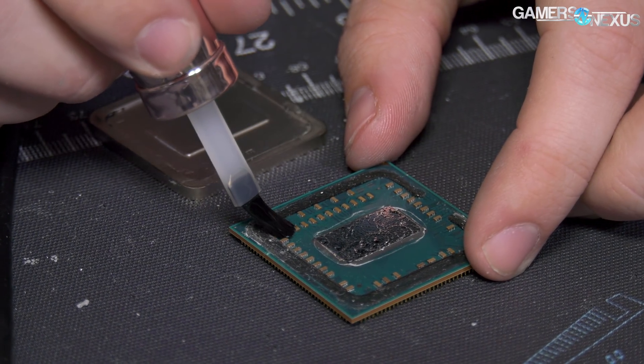When you should delid is when you'd like to have some actual thermal headroom to reduce fan speed — that extra headroom means you can bring the fan speed down and operate at the same temperature with a quieter mode of operation. Alternatively, it gives you more headroom for overclocking, or room to use a smaller cooler. If you don't want a 280mm, you can get a 240 or an air cooler and have the headroom because you've delidded it. The thermal transfer between the die and IHS is now going through a 73 W/mK liquid metal rather than roughly 4 W/mK for thermal paste. So from an enthusiast perspective it's worth it, but from a practical perspective it depends on your needs, since you can just throw a bigger cooler on it and get basically the same effect.